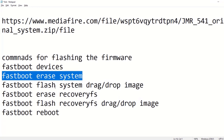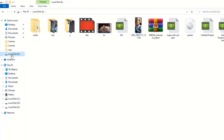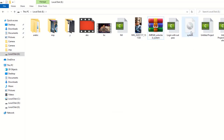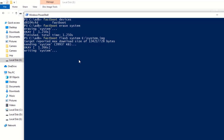Now put the third command: fastboot flash system. Type 'fastboot flash system', then leave a space. After that, you have to drag and drop the system image file into the command window. The image is saved in my E drive — that is the name of the system file. Right-click and extract the zip file first, then drag and drop it. As you press Enter, the firmware will flash onto your router. The writing process will write the new firmware to the router.